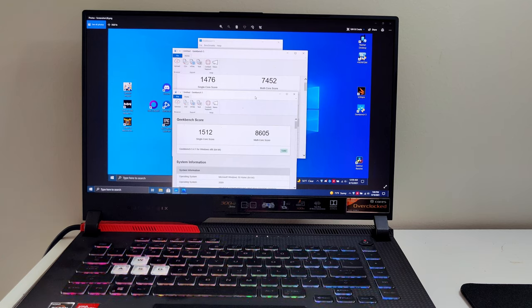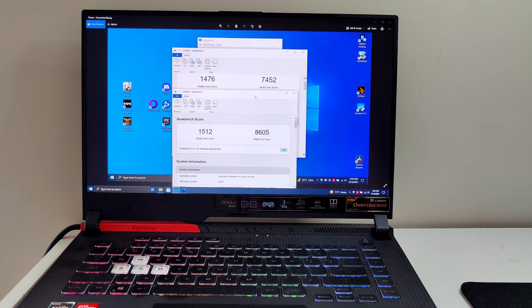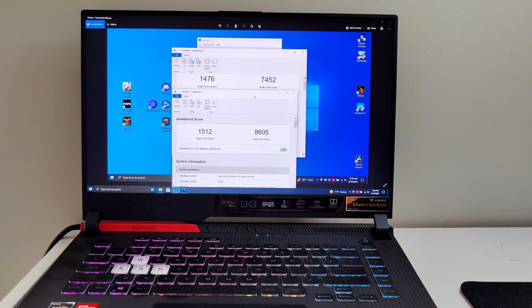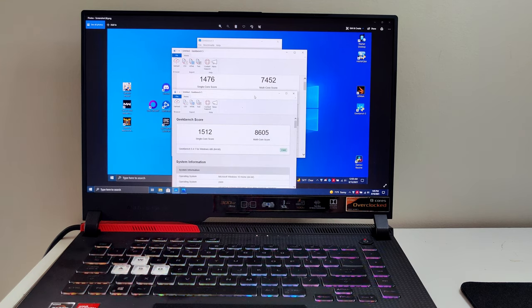And you don't have to spend $250 on 32 gigs of it like I did. You could go spend $150 on 16 and probably be fine for a while. I just figured, why open the thing up in another couple of years when I could just shove 32 gigs in there? Besides, when you do video editing and stuff like I do, 16 gigs of RAM tends to not be enough, even if you're just doing basics. That is, unless all you're gonna do is video editing. Just having Chrome, a couple YouTube tabs up while I was doing a video encode, and I was sitting right at about 14 gigs of memory with DaVinci, Chrome, and a couple other things running in the background. So just saying that, obviously most people can just close applications and be happy with it, but I think this RAM upgrade was absolutely worth it.